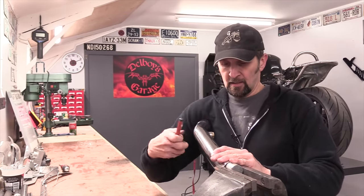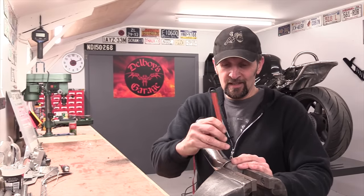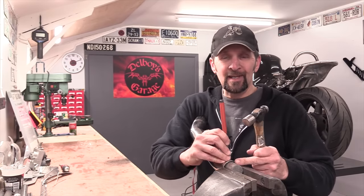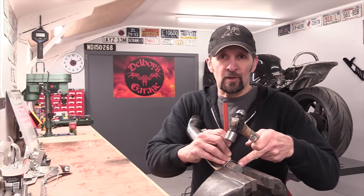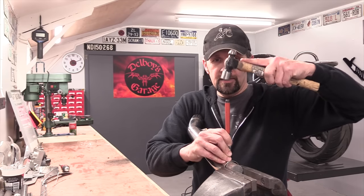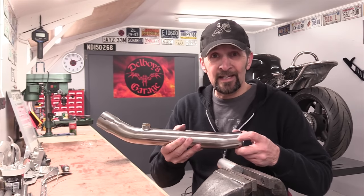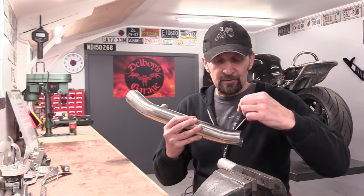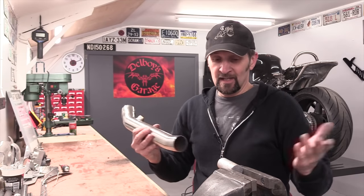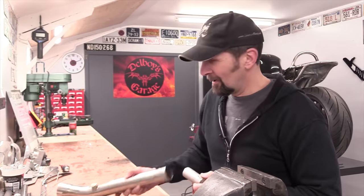And it's just a case, obviously it's a bit of a juggernaut, you know, wherever you're gonna do it, have a handy assistant to help you if you need, whatever. Then you can put the center punch on top, knowing that there's no space under that piece of tubing. It's gonna go straight into the piece of bar stock, your little anvil, and accept it, and you'll get a nice clear center punch first time. Also, the other side of it is, you don't need a great big crater of a center punch. This is stainless steel. You just need enough for the drill bit to grab hold of and start going through where you intend it to. There we are, simple. So whenever you find little bits of bar stock, that sort of thing, don't throw them away. They're always useful. Ain't odd, is it?